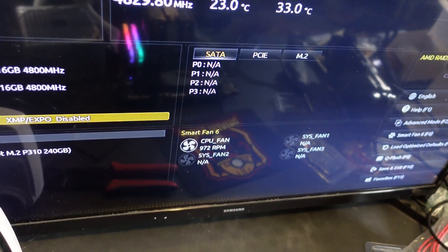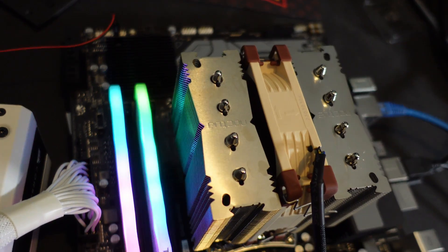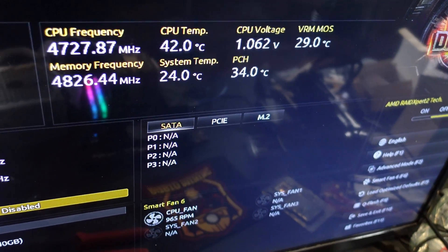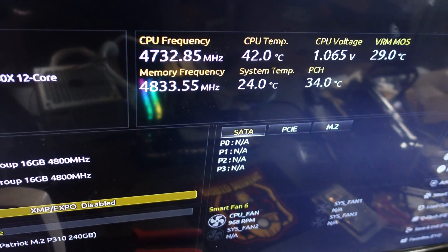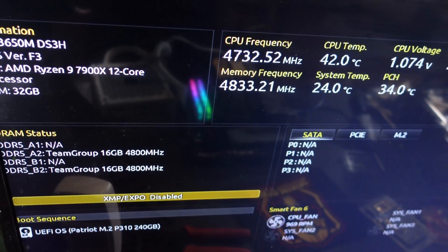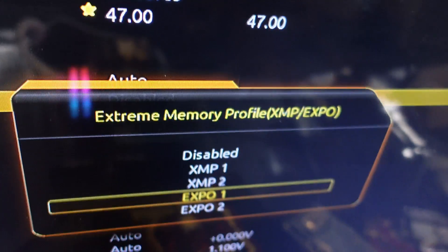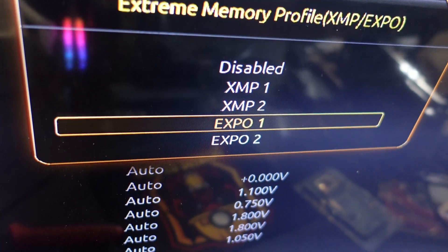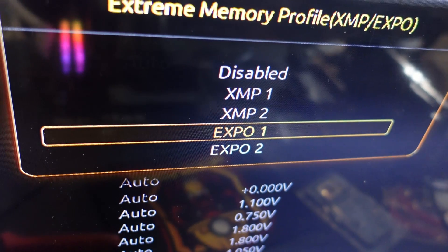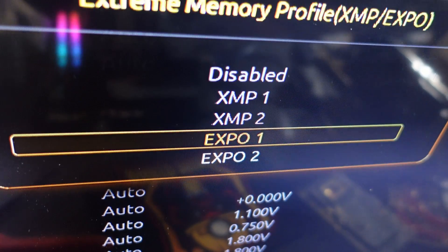Success — we are inside the BIOS. Things are looking pretty nice. It is dead silent. I want to set it to the base clock, which is about 4.7 gigahertz, and run at about 0.97 volts to see if it'll boot. I also have the option to use XMP or EXPO for the RAM. The RAM box says XMP Intel certified, but since this is an AMD system I'll try EXPO one to see if it boots.